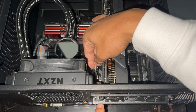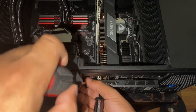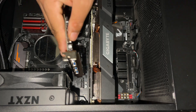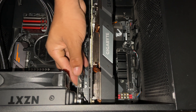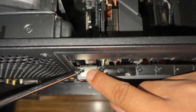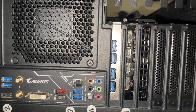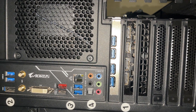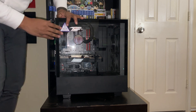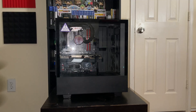And it's that one. So as you see my finger pointing there, we're just going to screw the protector off of here on both sides, take the side off, take the screw off — we're going to save this screw — and then we're just going to slide the case cover off of the case just like so. Then we're actually going to install the part. It's pretty simple: you just put it in. The long side goes where the long piece is and the short side goes with the short pieces. You might have to move the bracket down a little bit — it's fine, you're not breaking it. Just move it down and screw in the screw that came off of the case cover. And this is what we're looking like right now. Now that it is installed, all we have to do is put everything back on just like how we found it. Take our case, put it back up, put our case cover on, make sure that we clip everything on how it's supposed to be, screw that in tight. Moving on to the backside, we're just going to screw the mounting cover on, and we are good.